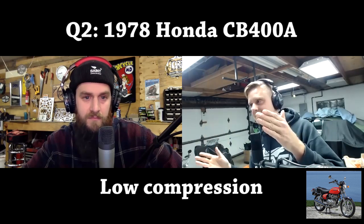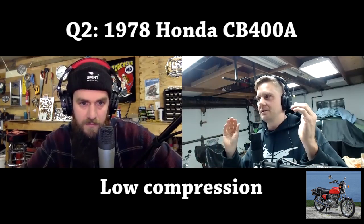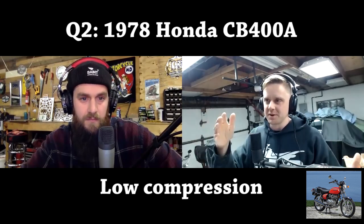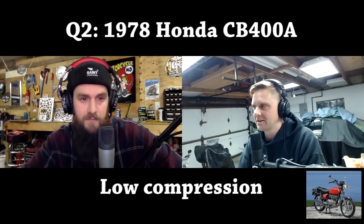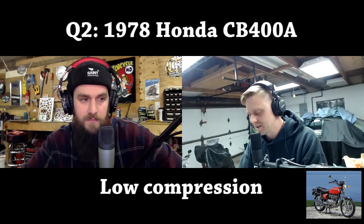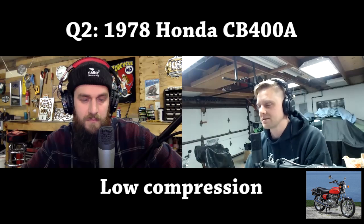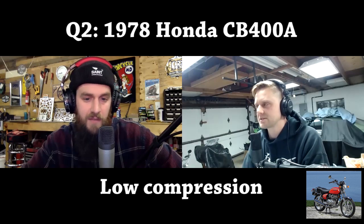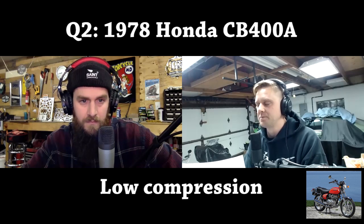But anyway, let's say you do a compression test and it's low. Go to the next diagnostic tool to confirm your results from the first test. Bingo. Good advice. Yeah. So let's say this engine here for Ace. Okay. So he has 75 on the left, 90 on the right, whatever. 75. So, okay. Then I hook up a leak down tester and it's 50% leakage, which is huge.